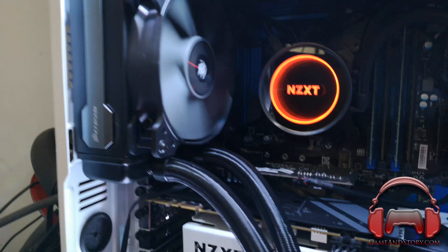And there we have the Kraken G12 mounted onto the Zotac GTX 1080 Ti Mini. There were quite a few challenges in trying to get this combination working together — I'll put the links below for you guys to see. As you can see, it has an AIO attached underneath. That says Corsair — this is the Corsair H80i V2. The H80i obviously has a thicker radiator than most rads; this is 49mm, compared to the usual 27, 29, 30mm radiators that you get on 120mm size.